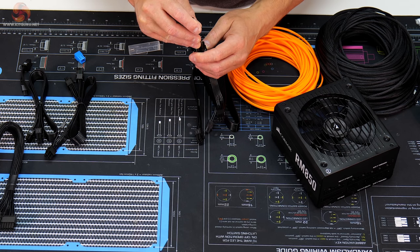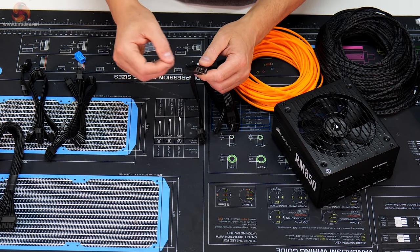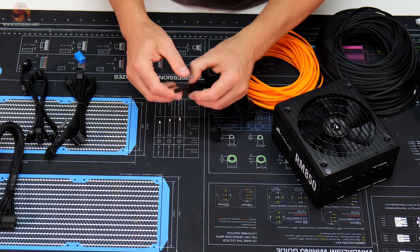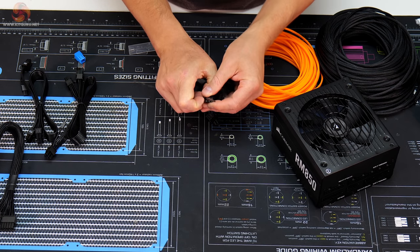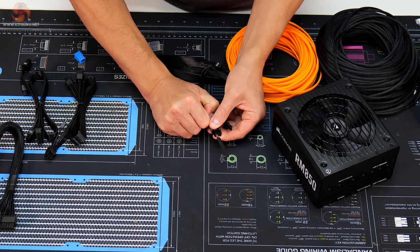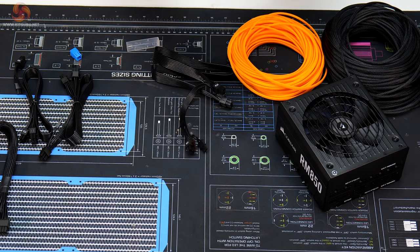So here goes. I just put it in like I would do normally with the staples. It actually felt like a little click, or a little notch when it located. So I think that's fully located. Now, if I just grab the right wire, it should hopefully just pull out, and it does. Looking at that terminal, it looks fine. So it looks like this has done the job.